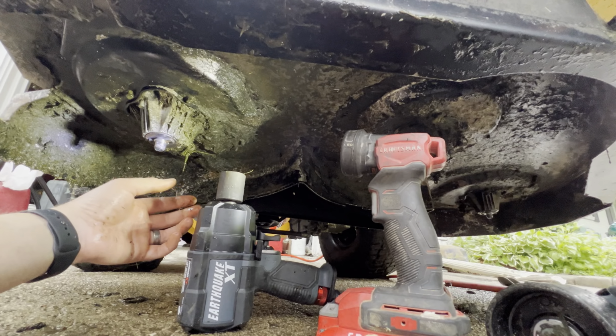All right, I've got all those new blades installed. Let's give them a spin once around just to make sure that there's no contact anywhere. And now we're ready to go ahead and lower this and then test them out. Also, these need to be retorqued after the first 5 hours, or I'm sure after one mow is probably fine to just retorque them after that.